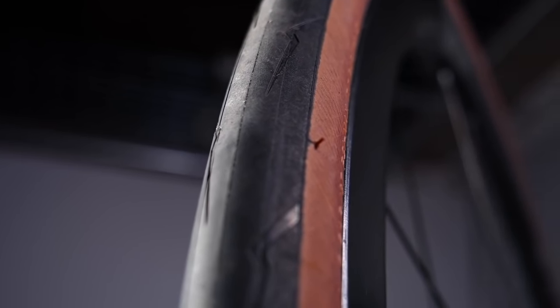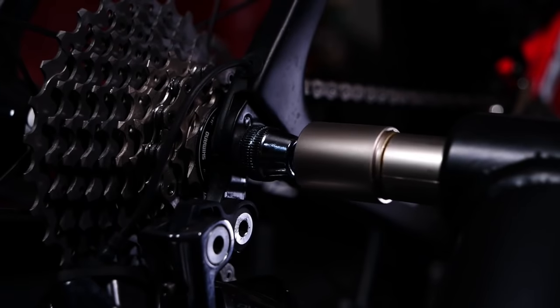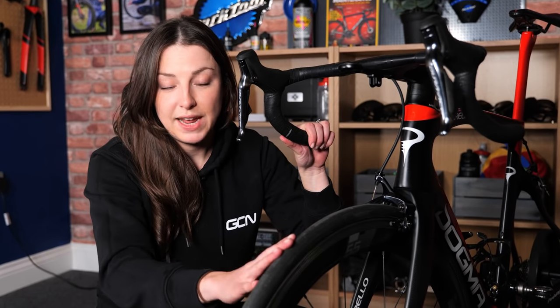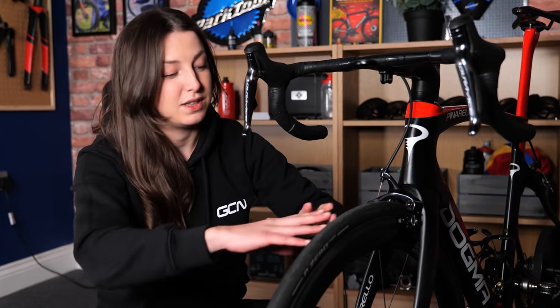Show your tires some love too. Depending on how long you plan on having your bike set up on the indoor trainer, you might want to consider a few things. Some people will set their bike up on the indoor trainer for all winter long and it'll be sat there for months. Make sure to keep your tires inflated and top them up every now and again, and rotate your wheels as well — this is especially important if you have sealant in your tires, because if they're in one static position it'll all sink to the bottom. If you are using a classic trainer, think about getting specific turbo tires. These tend to be a lot more durable and thicker. Using road tires will wear them down really quickly and essentially destroy your nice road tires, so it's definitely worth the investment.